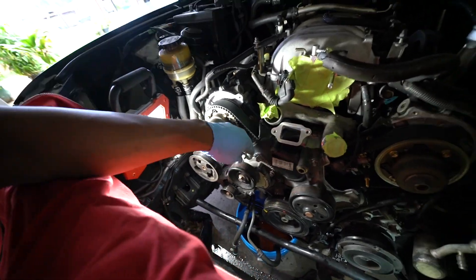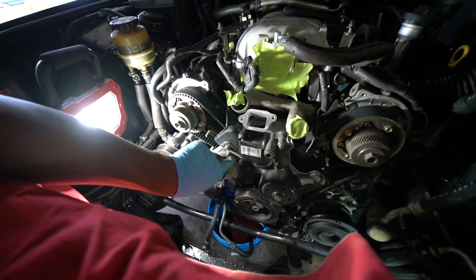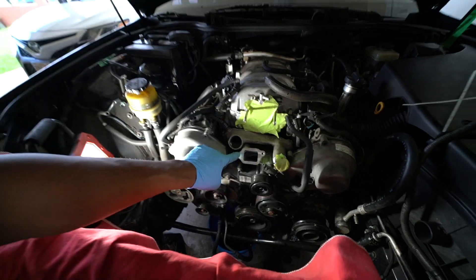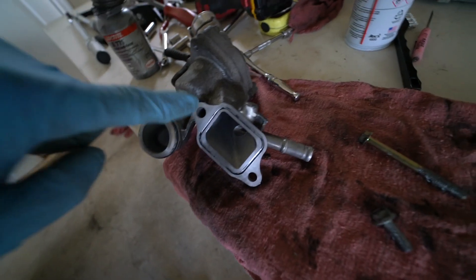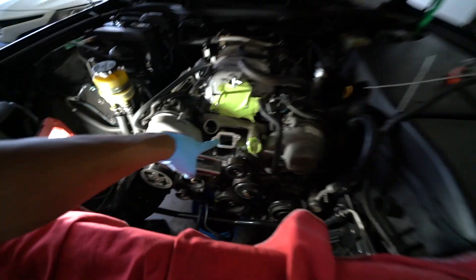Double check that these go back in sequence — this goes first, then the alternator, and then you've got to slip this cover in while you're putting it in. Got the covers back on. Working on the thermostat housing assembly — need to clean it off. Mine had RTV on it so I ended up buying the Toyota one. Put the RTV on it, replace this O-ring right here, and slap it back on — should go right here.